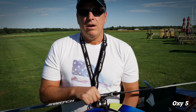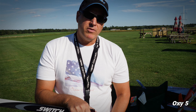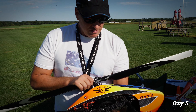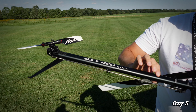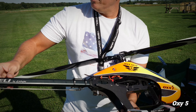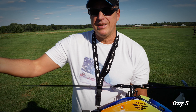I'm just running plus and minus 12 degrees of pitch. You don't need a whole lot — 2300 on the head speed and 12 degrees pitch is plenty. You can run it faster and have less flight time, but it suits my flying style. Another cool thing is the tail boom is square, so you don't have to worry about twisting it when you put it in. With a round boom you always have to line up the alignment, but the square boom means your tail is straight right away.